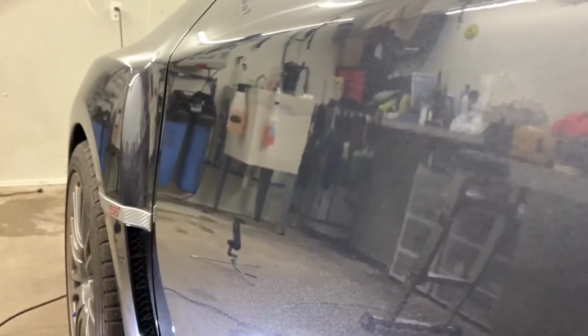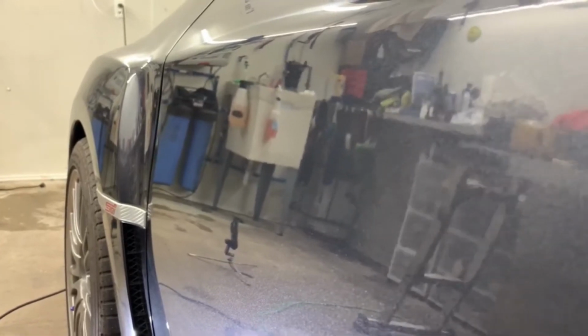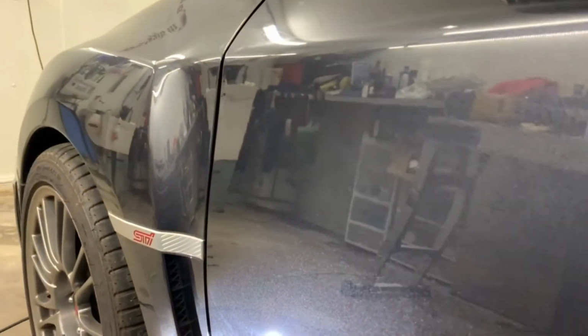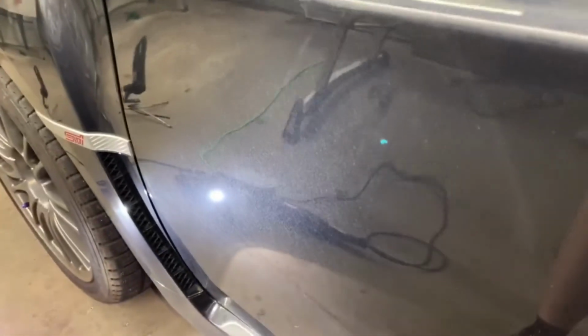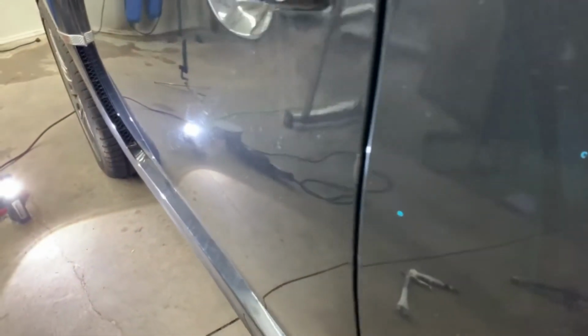That is Dent's Detailing two stage. What is it? Two-step paint correction? Single-step polish, cycled out twice using a diminishing abrasive. And if you look on the part that wasn't polished, a little dirty.